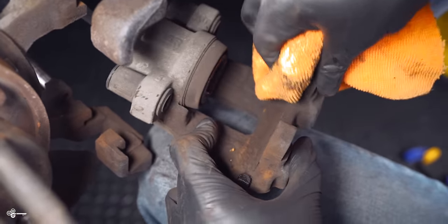Now, one of the last things you have to do, especially when you're doing new rotors and also pads, you have to properly bed the brakes in, which is going to help them perform and also last the longest. So for more information on that, we have EBC's specific recommendation down in the description. Once you're done doing anything on your brakes, most important step is to pump your brakes. You want to fill those lines back up with brake fluid. Otherwise, when you start to drive away, you're gonna hit the brake, it's gonna go to the floor, and you're not going to stop. The other thing you wanna do is pop your hood and just check your reservoir, make sure that your level is still fine. And if you need to, you can bleed your brakes, and we have a video down in the description that'll walk you through that process.